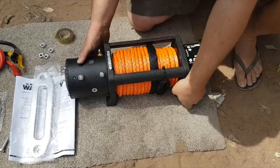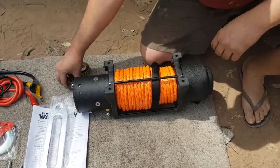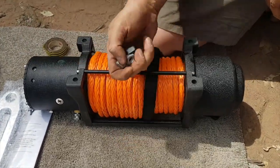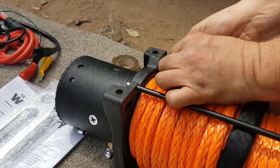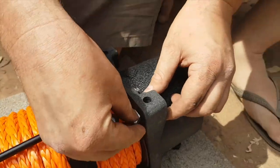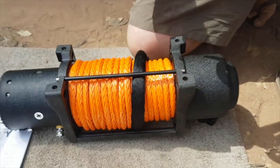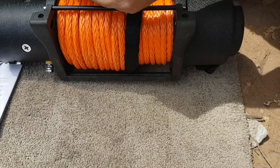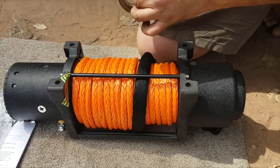You can see the area we've opened up. Before we start to install this, what we're going to do is roll it over and get the four square nuts, install them through the holes in the center there. Just get some electrical tape or some kind of tape and tape them off so they can't fall out when we go to stick it in.